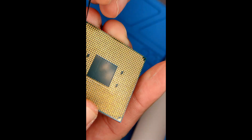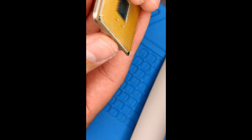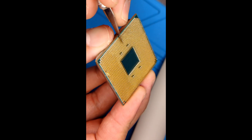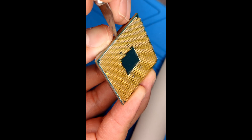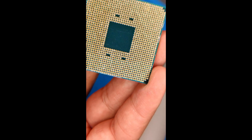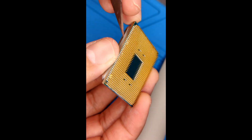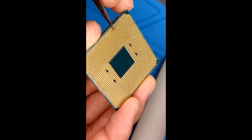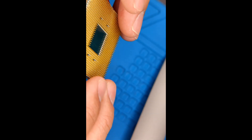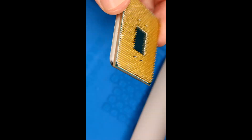There are still more bent pins on the sides, so I'm going to a different angle to check for errors. You've got to be gentle — if you go too hard and pop a pin off, that's it. Bending a pin is way easier than soldering one on. Now I'm going to the second area, using the X-Acto knife. It's good to have both tools — I like the screwdriver a lot for the edges because I think you can get a better bend. It looks like this one is repaired.